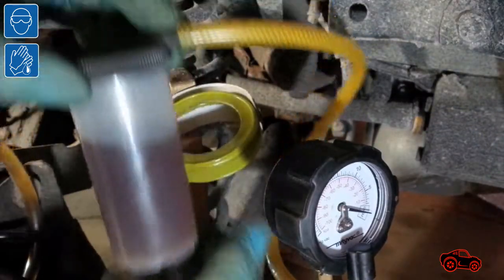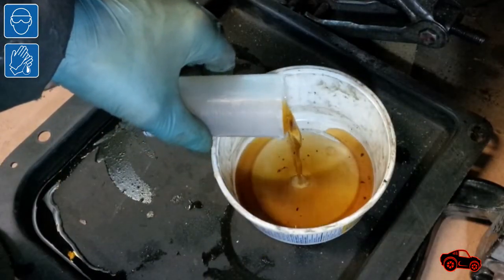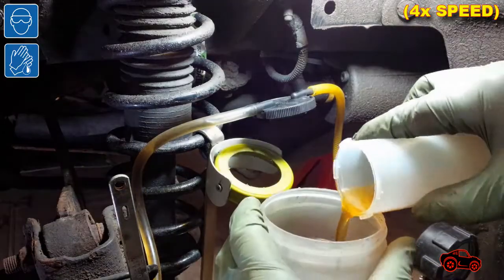At the beginning of the job, I always use more brake fluid to bleed the first wheel, because the fluid in the master cylinder reservoir has to be renewed. As reference, I had to bleed around 16 ounces of brake fluid when I worked on the first brake, but when I bled the last brake, I only needed around 4 ounces.